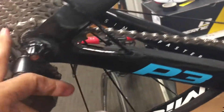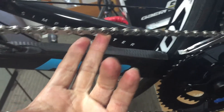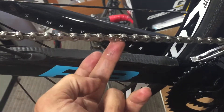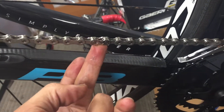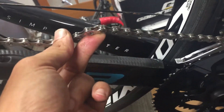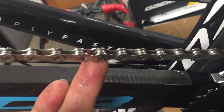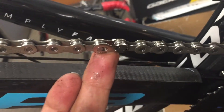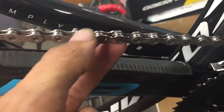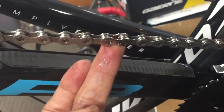The chain needed to be replaced, so we've got a new fresh chain on here. With the new 11-speed chains, Shimano has finally moved into the times — they now allow a quick link, but it's their quick link and it is very hard to install. It's supposed to be one-use only, but we have seen customers reuse them because they've taken off their chain and reinstalled it for ease of cleaning.